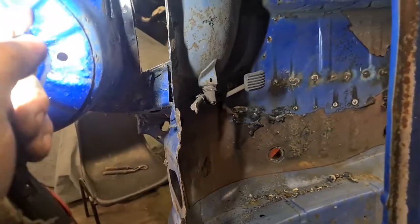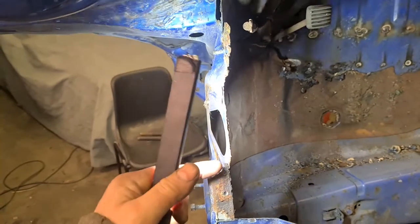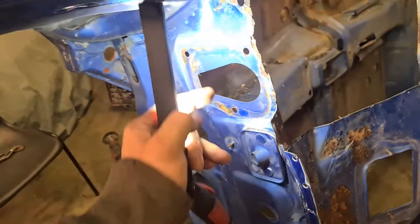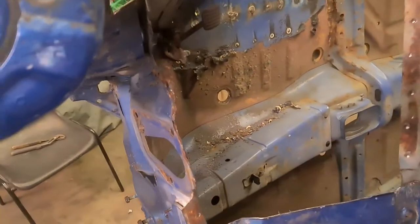So building it back up in the layers, like I've always said, when you take it apart, you should always try and take it apart and see how the layers go. So what I'm thinking is this piece here is first. So I need to build that lip up. Also need to do a bit of work across here because it's a bit rotten down here. So I'm going to trim it down over and just basically put a leading edge on,